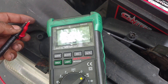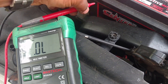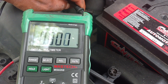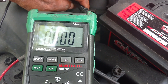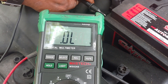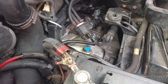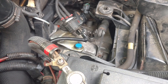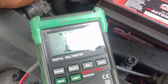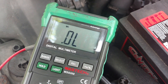Let me get the pins where they touch. When I touch them together, it tells me I have continuity. When they're apart, there's no continuity — it goes back to low. So when your vehicle is not in reverse, it should be just like that: no continuity. When you shift it into reverse, you should show continuity.